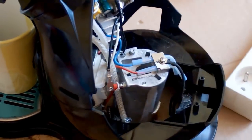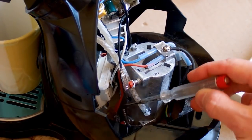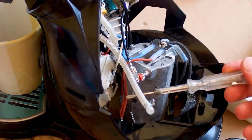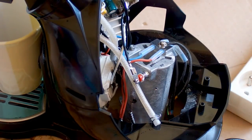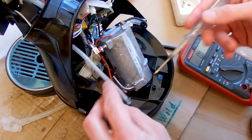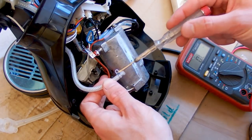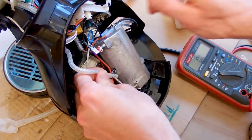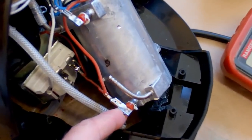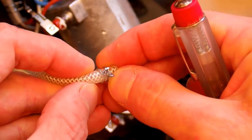I'm not sure what happened but it's very hot. This hose basically was blown off this pipe - it came off probably by overpressure. It seems like it's clogged somewhere, probably by minerals from water, so it pressurized and burst. It basically blew off this pipe, and accidentally this metal spring on this hose made a short circuit between the metal body of the heater and some terminals on the pump. You can see the mark on it from the short circuit, and also a mark on this spring.